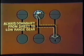Failures will also result if you downshift directly from an overdrive ratio to low range. Remember, if you are in overdrive, be sure to downshift to direct before downshifting to low range. Attempting to start in too high a gear, or starting in high range, can cause twisting of the main shaft, resulting in hard shifting or locking the vehicle in gear.